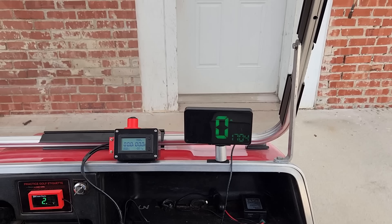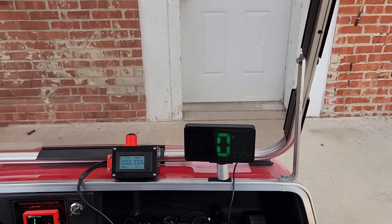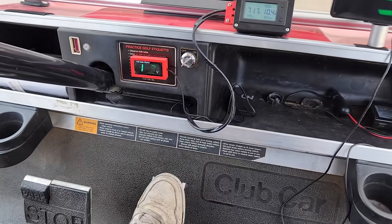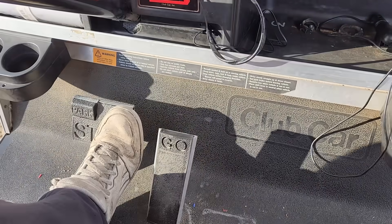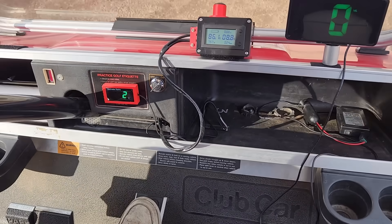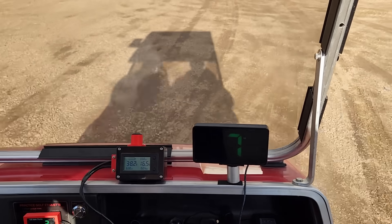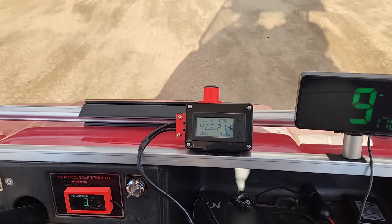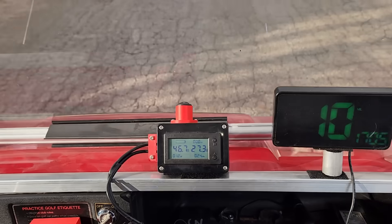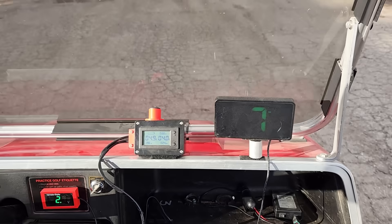I can show you folks that the onboard charging system actually works. This meter here shows the voltage at the 12-volt battery. The way we're going to confirm the onboard battery charging system is working is to keep an eye on this gauge — when it goes above 12 volts, that's confirmation the battery is charging. What we're doing is skimming some of the power going to the drive motor and sending it to the battery charging circuit. The golf cart needs to be moving for the onboard battery charger to work, so basically at speeds above 5 miles per hour, we're sending juice to the little 12-volt battery. The onboard battery charging system is capable of making 10 amps, which is plenty of power to keep the little battery charged.